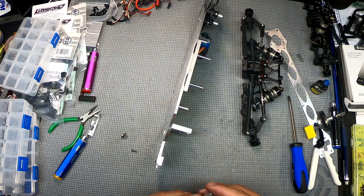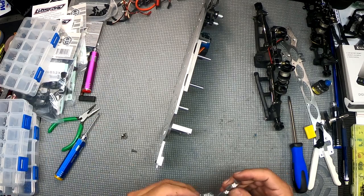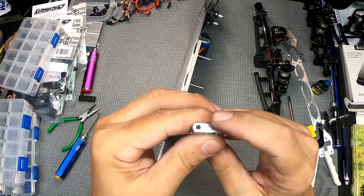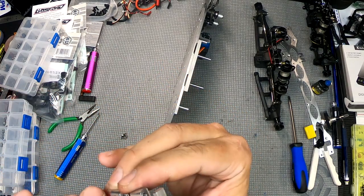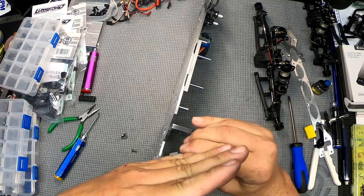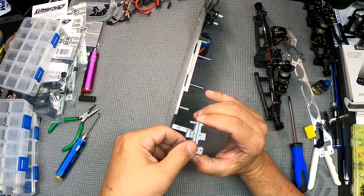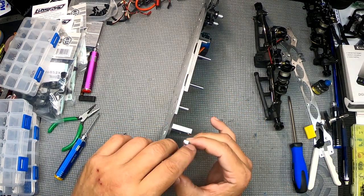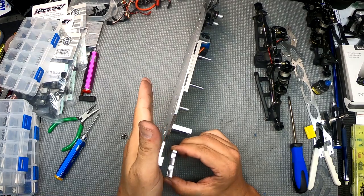This is interesting - things to pay attention to. Look at where the hole is drilled in here - it's down near the bottom edge. If you turn it 180 degrees, the holes are coming out high over here. So these holes are drilled at an angle. That's giving us some kick up, basically like rear caster. This tells us which side these are going to go on, because if I flip them upside down I've got downward kick, or the opposite.